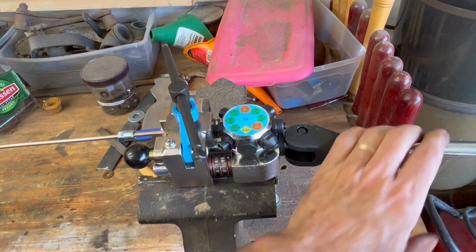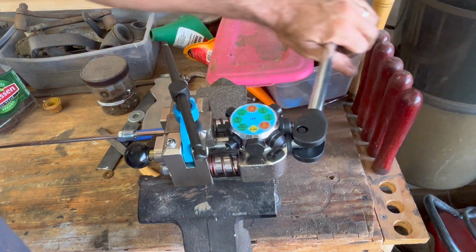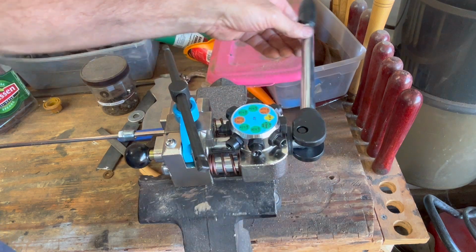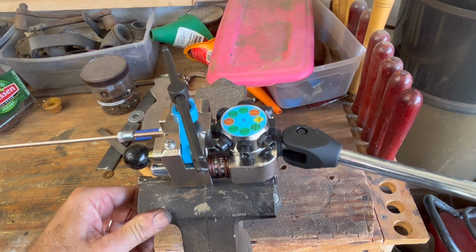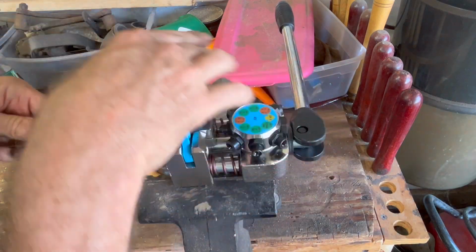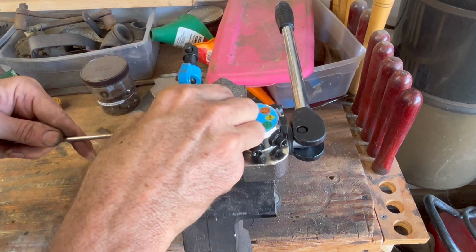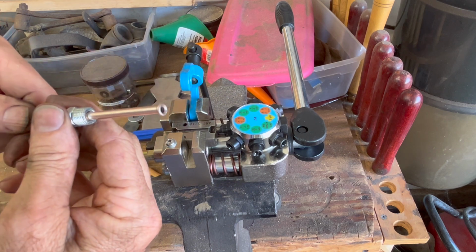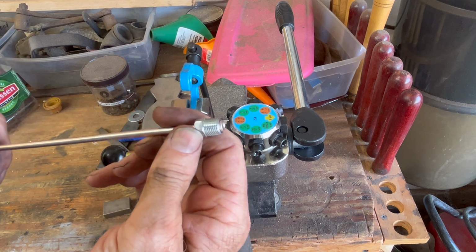come around the other side of the camera. I back it off, turn it to operation 2 3/16. I pull it, that should be it. Loosen the die, flip it back, and what you have is a really nice double flare, which is what you want for brake lines.